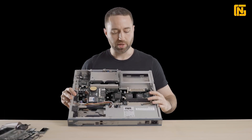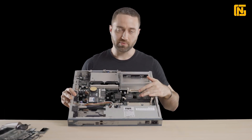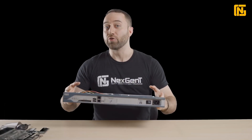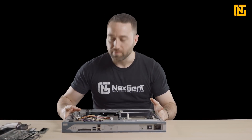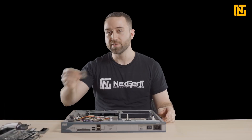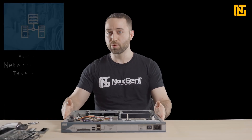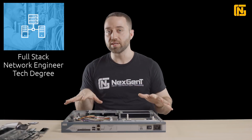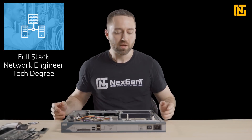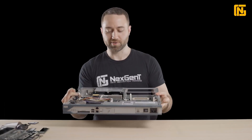PVDM is just for voice. We also have other memory components built into the board — the read-only memory and the NVRAM, non-volatile RAM. There is another memory component we already discussed: the flash memory card. Of course we do have a lesson in our program where we describe all these things in detail, but this video is specifically for looking at the inside of a router.